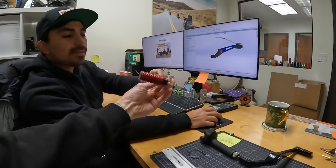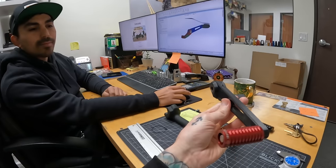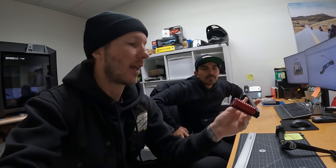That's going to be the next step. So grab the 3D printed one — you guys saw we pulled this out of the 3D printer on the last one. This is the part kind of assembled and ready. Let's go throw it on the bike and show them how it works. This plastic is actually strong enough to where we can throw this on the bike and actually ride it and get a decent idea. You wouldn't want to go on an all-day ride, but just in the parking lot at slow speeds, kind of playing with it and making sure it works the way we need it to before we go to actual prototype with billet aluminum.